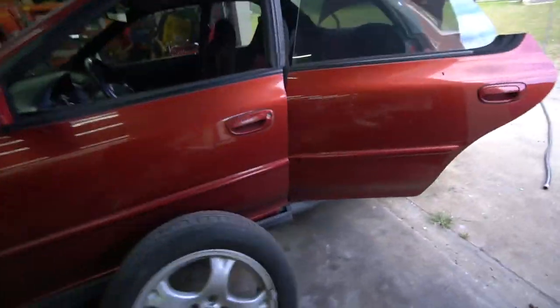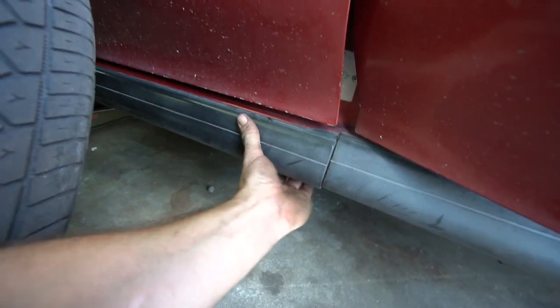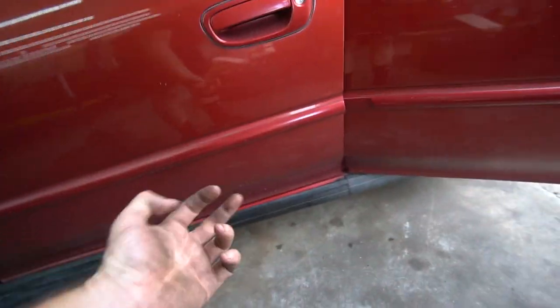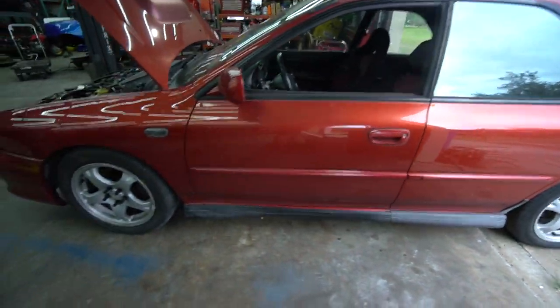This side skirt thing, I don't know. It's still dangling. I guess it looks like it's missing a bracket down there. So I'll mess with that next. All right, sweet. So I figured out the side skirt. Basically, there's some bolts that hold it in and it had ripped through. So I just put some bigger washers on there and pretty much fixed that.